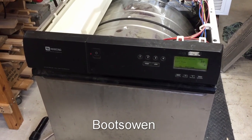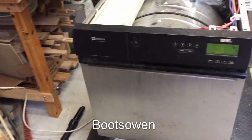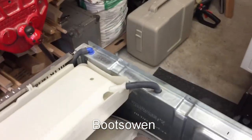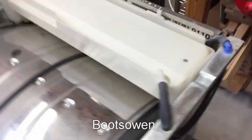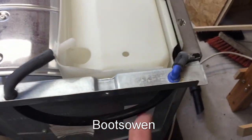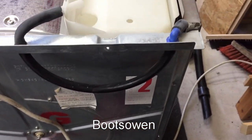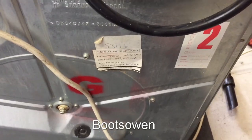If you've got any ideas, tell me about them — this is as much as this video is going to have. I'm not going to go through fault finding. I'll post this video and read the manual in the meantime — that might help me a bit. I don't think there's anything simple like overflow. Water comes in here — if you look at the back, water comes up from the pump. There's a pump in the bottom below the condenser. Water gets pumped up, goes in here and back into the top into this drawer. If you want to plumb it into a drain, you can pull this hose off and put it into a drain like a washing machine drain so you don't have to empty it manually. It says on it it's a graded appliance from 2003.